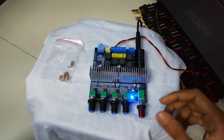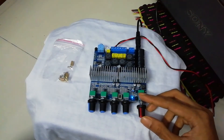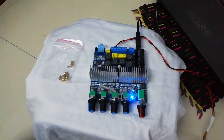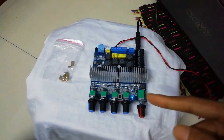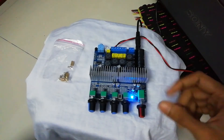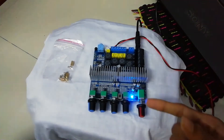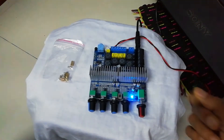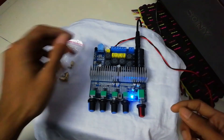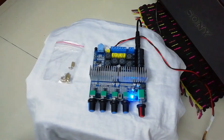To switch from Bluetooth mode to AUX mode, you first need to disconnect Bluetooth from your phone. Once you do that, the unit goes back into Bluetooth pairing mode. Then just give the master knob a single short press, and it switches to AUX input mode. If you have a woofer connected it will show 'line in.'